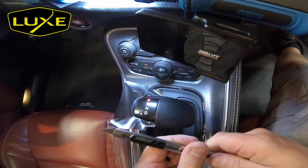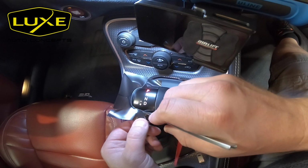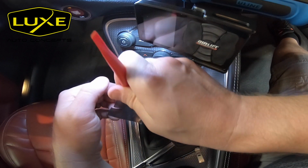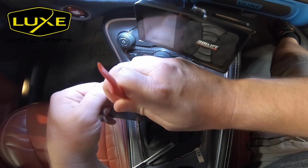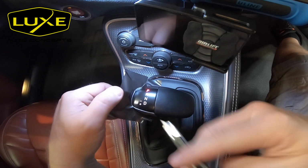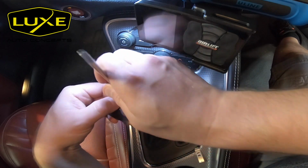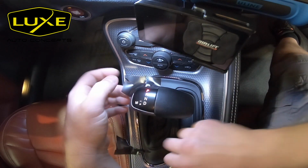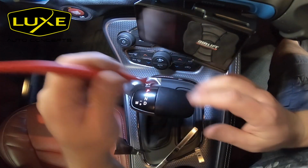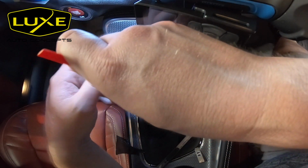This here is a 30-degree vinyl blade, and it is super thin and super sharp. Allows me to stick the knife into that little crevice and ride the line. Now this here is really delicate work, so you don't want to be using like a sheetrock cutter and a Sawzall to get this done. You want to get the right tools so you don't make a mistake and slice up your interior. The good news is these tools are really inexpensive. I'll put a link in the description below to both of them, but definitely go for a really super sharp fine blade for this job, because that crevice there is really small, and if you have a sharp blade you can get that vinyl cut perfectly where you can't tell there's vinyl on there at all.